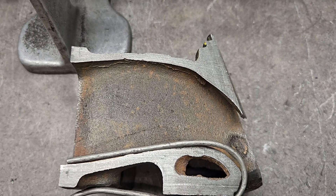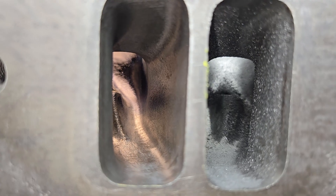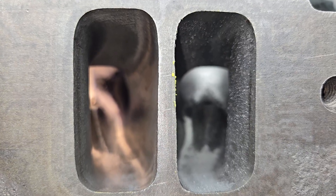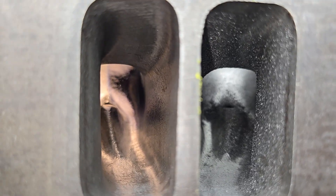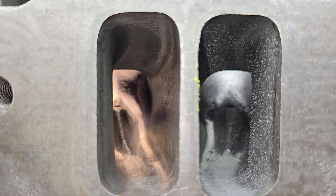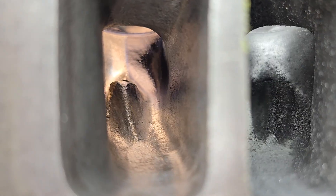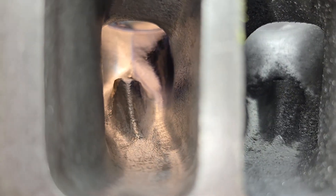Let's take a look right down its throat. The opening is a little bit taller. These do have googly-eyed ports — they don't match. So I'm not going to go nuts until I get the gaskets for it and get a better idea exactly where they need to be. These are still a little bit smaller than the 340 intake openings. We've loaded this with some porting done to it.